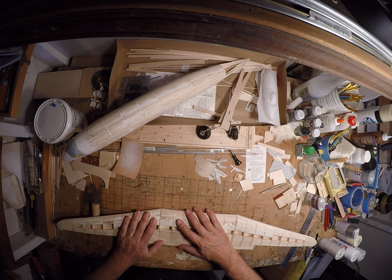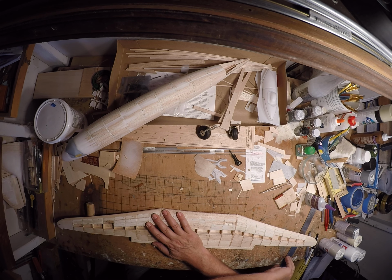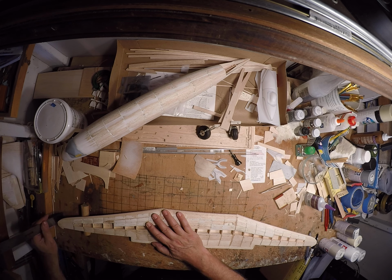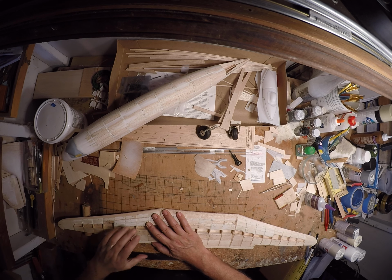So we're going to try and lay this up here at the right height, 1 9/16. Bring the ruler over and just check the dihedral. Now we're a little high on this side, so we're going to roll that back to 1.5 inches, not 1 9/16. A little bit in. That puts us right where we need to be at 1.5 inches.